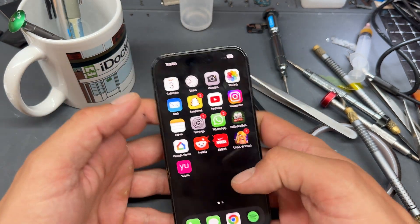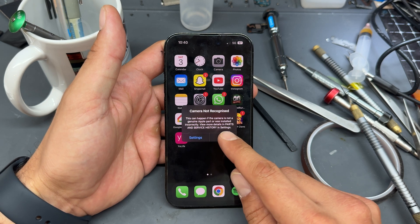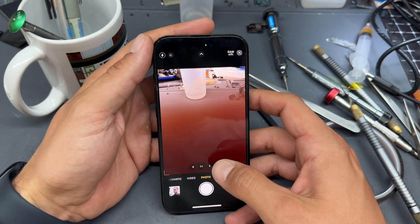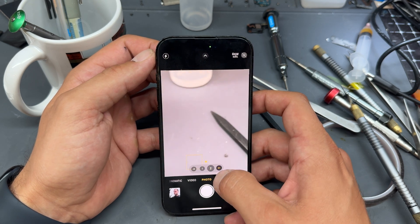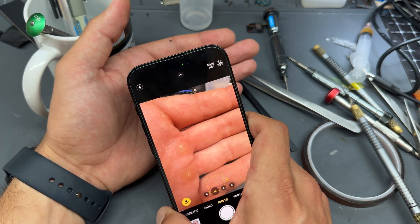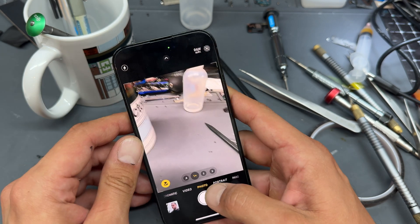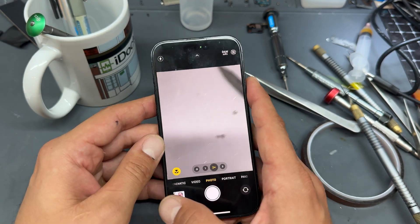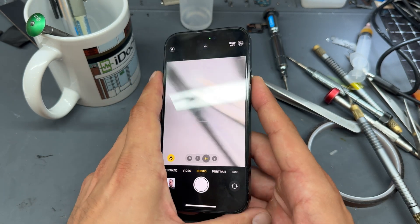When this phone boots up it's going to give us a camera not recognized message, like I discussed at the beginning — that's not a problem, we discuss it with the customer in advance. We can see that all camera modes are working as they should. It's a good idea to do a close-up test and make sure that the focus changes in and out on all cameras — 2x, 3x etc. I'm confident that this repair is now complete. Thank you for watching and see you in the next video.